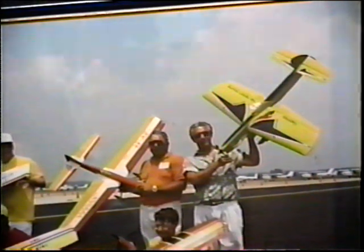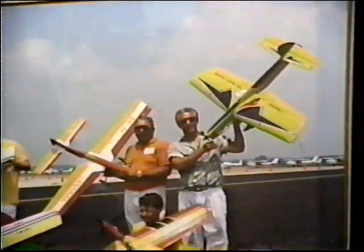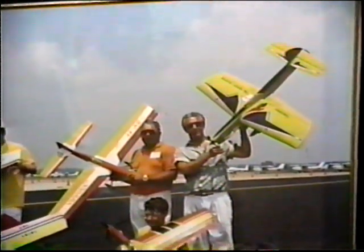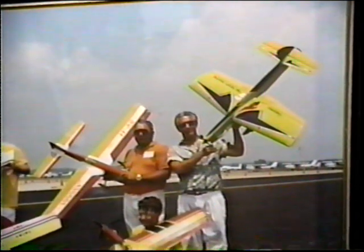Anyway, the reason Mike ran the motor is he had some concern that he's got three full seasons on it. Because he had the plane all apart to clean it and winterize it, he wanted to run the motor on a bench and see if it needed anything, a bearing, a ring, or anything. We took it all apart. Everything looked exactly the way it should. We put it back and it ran just the way it should. It's not uncommon for these motors to go very long times. So Mike's going to put it back together, and we're ready to go as soon as we get some flying days. Boy, is it crappy out there now.